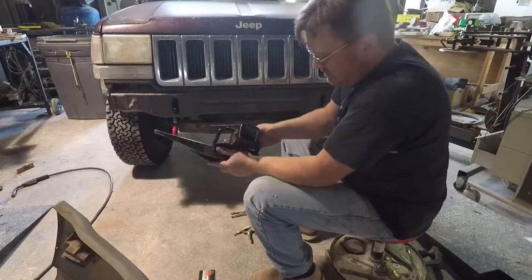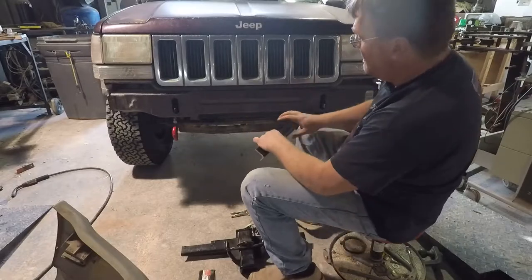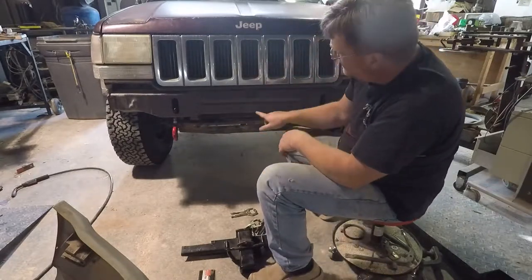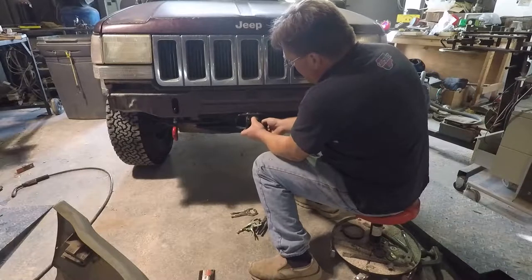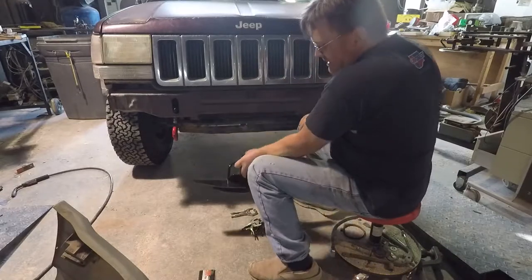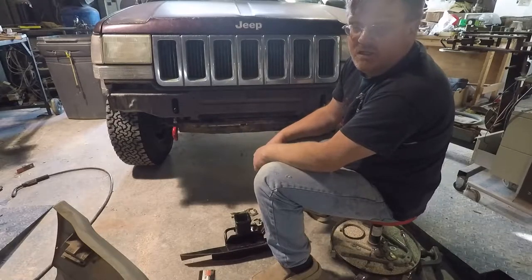This is just sheet metal right here. Here at Low Buck Garage we use the whole carcass, so I got another piece of the hitch I cut out. Slide that underneath and behind. I'm going to pop some bolts in here to hold that plate in place — then that tab is going to drill right through it. We're going to have one big bolt sandwiching the sheet metal to the reinforcing plate behind. Now I'm not actually towing on the road with this — that would be an accident waiting to happen — but for maneuvering around the yard or launching a boat, this should be perfect.